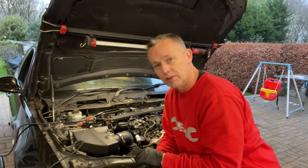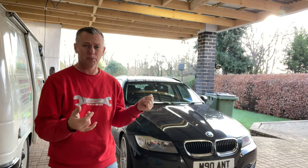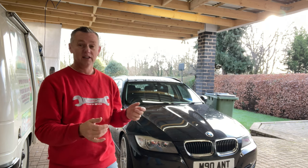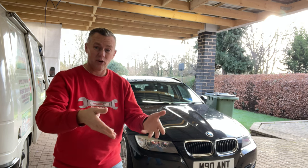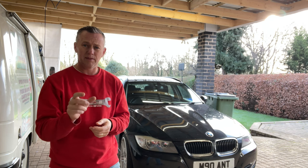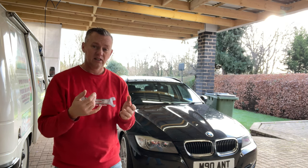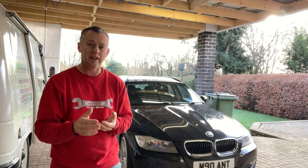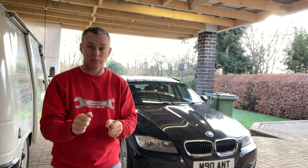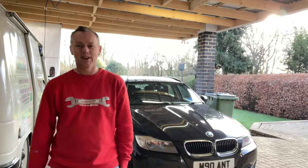I've just been down to BMW — £280 for the new plastic cover, but it's got to be done. We'll whip the injector rail out, get the injectors out, get the cam cover off and have a good look. I cleaned it all down and didn't see anything wrong with it, but there must be something there. So that's it for this episode — what a nightmare. We've got to get that changed over, which will be in the next one. It's an episode I didn't want to make. We'll have to strip it back down — injectors out, inlet manifold off, the whole lot off the top again to get that rocker cover. We've also got those fault codes that still won't clear, so I'm a little concerned about spending another £300 on a rocker cover with that issue still present. Join me in the next episode — drop me some comments, give me a thumbs up, like, subscribe, see you in the next one!